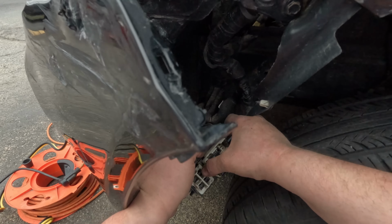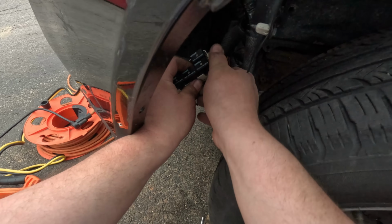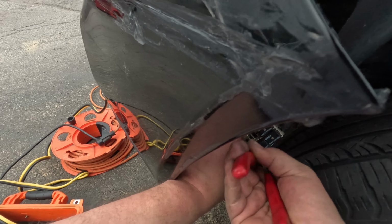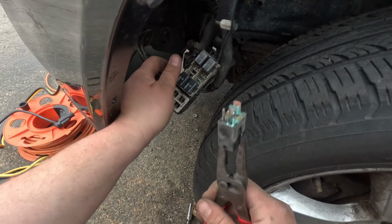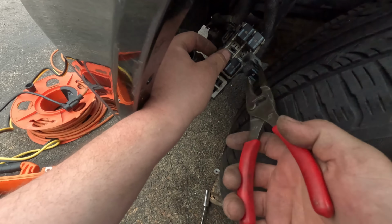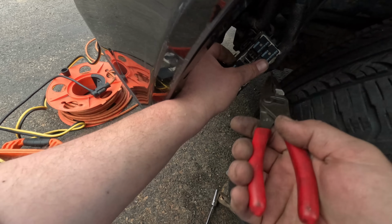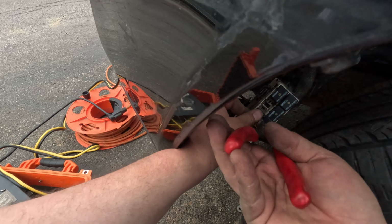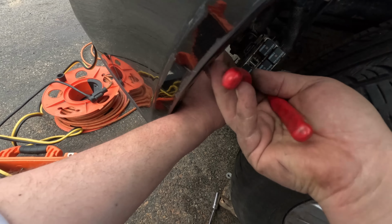Okay. Now, I have no idea which one's the ASD relay. I definitely see corrosion right there. Ooh, yeah, you see all that corrosion? Look at that. Alright, this thing really needs a new fuse box. Maybe I can clean it up just enough to get it to work and show them what they need, because we have another one. He has the exact same car that he's junking tomorrow. You can take any parts. Yeah, this box is all corroded.